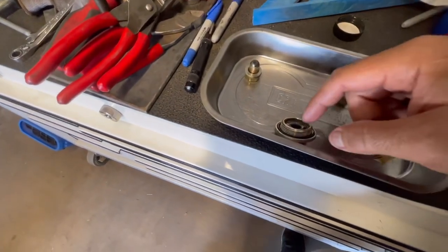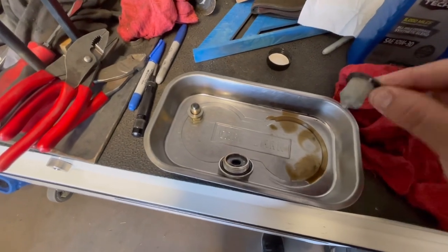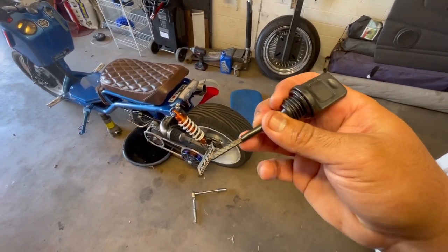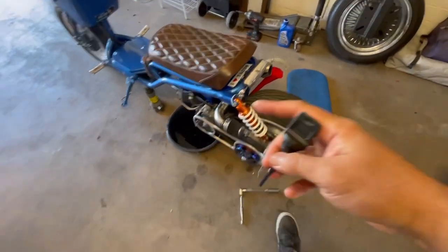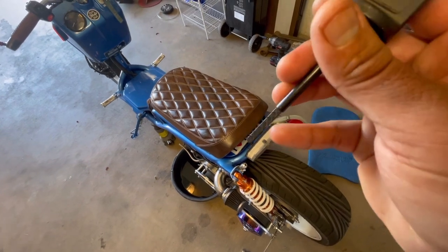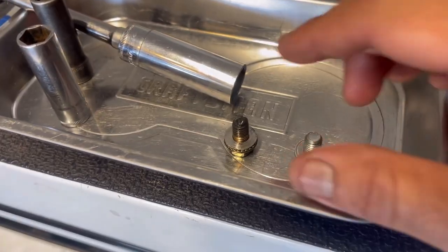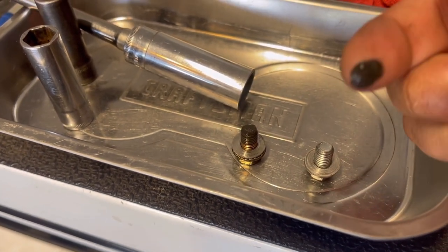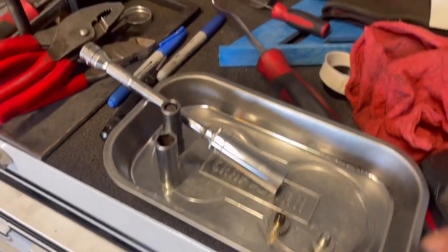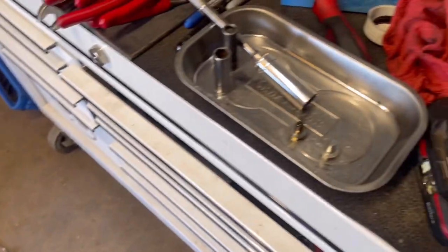There's definitely metal on the magnets doing their job - I don't see any metal in the oil itself, they look pretty clean. I filled it up to the upper end of the spectrum last time; I'm gonna have it on the lower end this time because I was having some oil seep out of the decompression tube. The magnetic drain plug for the final drive differential also has some real fine metal on it - this is normal, I was expecting this. I wasn't expecting to find it on the engine drain plug.